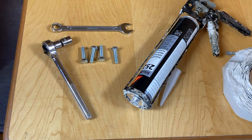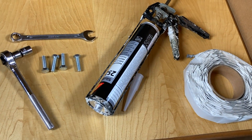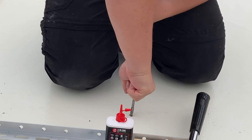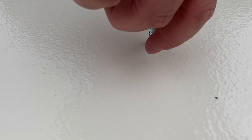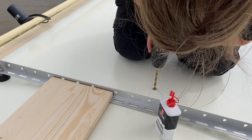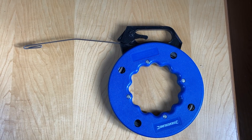The last thing to think about is what tools you're going to need — you don't want to be up on the roof in the wind and discover you've forgotten a critical tool. You'll likely need some or all of the following: if you're drilling into the steel narrowboat roof, you need an appropriate steel-cutting drill bit in the right size, and a tap and die set to cut the thread for the bolt attaching the panel. We also used oil during drilling, and applied butyl tape around the screws to make the connection watertight.